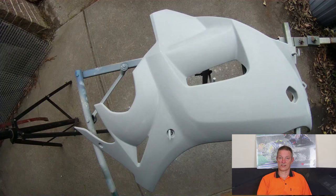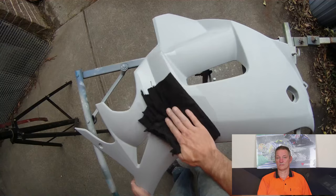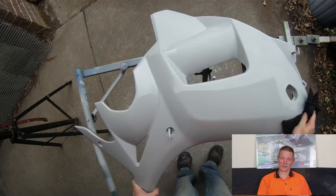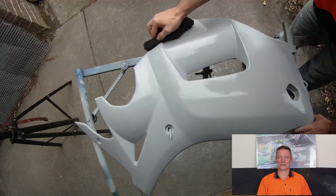This is dry. We've given this a little rub — very slight rub, maybe 600 grit, even a bit of scotch brite, grey scotch brite. Get it relatively smooth; it doesn't have to be perfect, it's just got to be smooth. Scrub it again with wax and grease remover, get it all done so it's all nice and clean. Make sure that it's clean — it's very, very important.